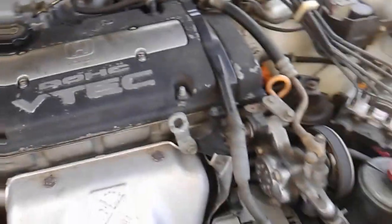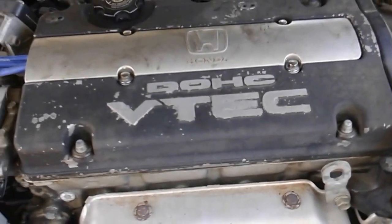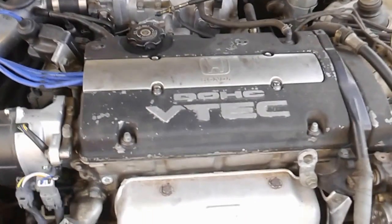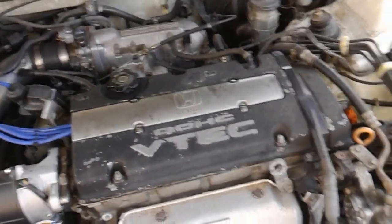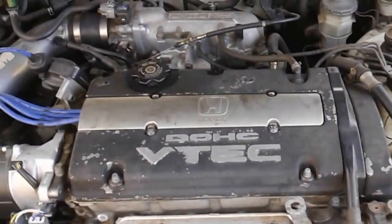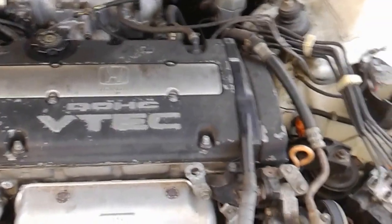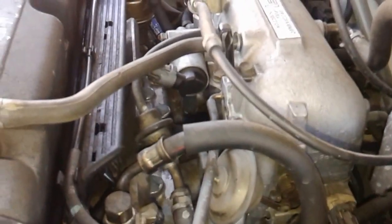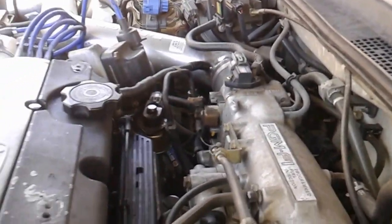Overall my engine runs pretty good and I do not leak oil. VTEC — just took out the solenoid, cleaned it up after I did a full tune-up. Did my valve timing adjustment after I took the valve cover off. Should have painted it but didn't have time. My liquids are pretty good. Took the EGR valve off, had it professionally cleaned. Throttle body cleaned. My valves are in pretty good shape.